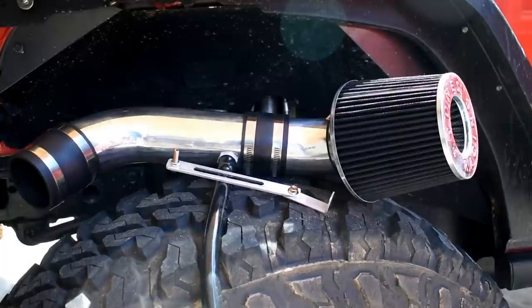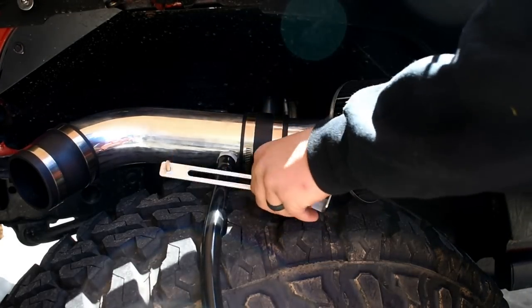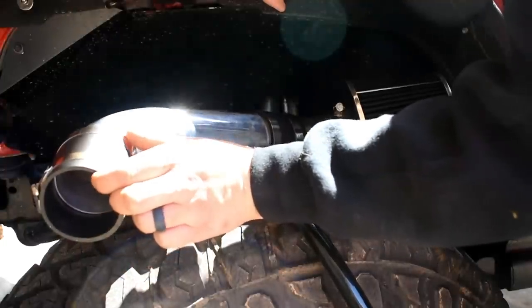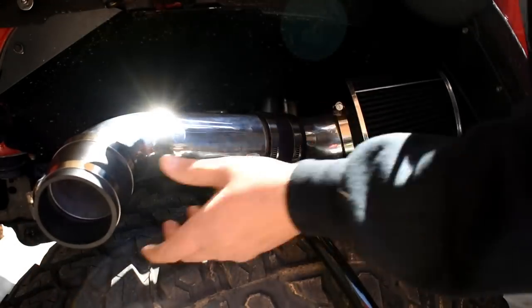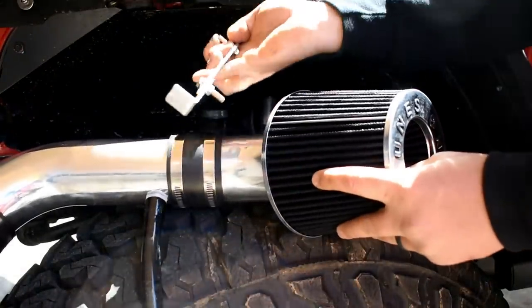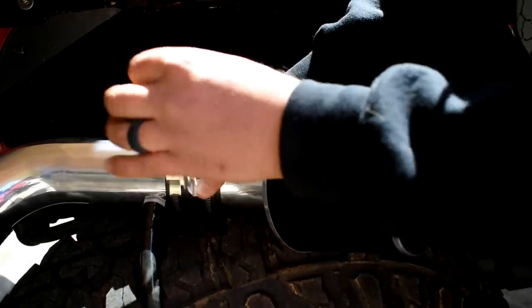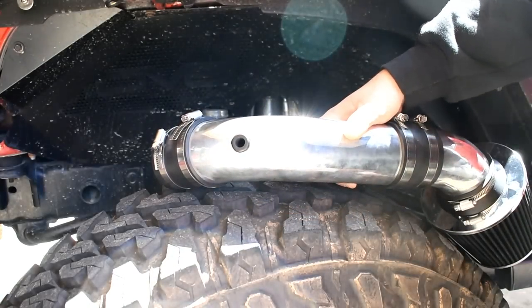Let me talk a little bit more about this intake kit I got. I got it on eBay - I want to say it was 40 or 44 bucks, free shipping, and got here in a couple days. It came unassembled, but the assembly is super easy. You have your little reducer silicone hose that goes from 3-inch to 2.75-inch for the JK throttle body, all your hose clamps, a hose, a little fitting that came pre-installed, your air filter, and a little universal mounting bracket. That bracket tucks under the hose clamp to support the weight of the filter. It also comes with a grommet for the intake temp sensor.